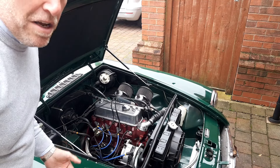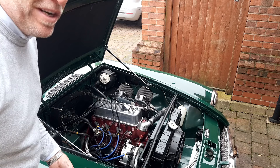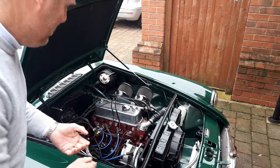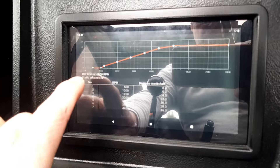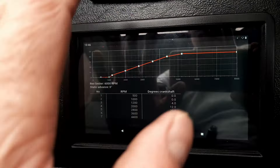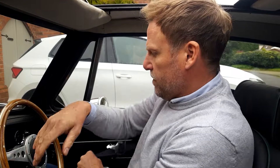It's running at around 1000 RPM. I want to add another 13 degrees — that's the maximum from my engine build sheet — and I'll go from there. I've updated that. The curve's going to follow up nicely now. I think this will probably work better at higher RPM — let's give it a try.